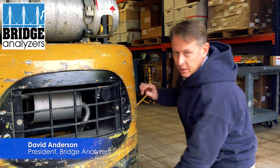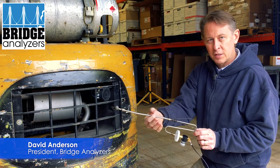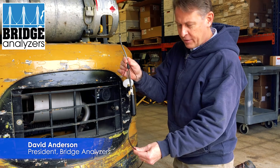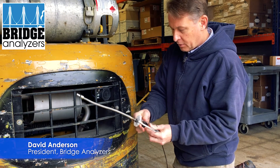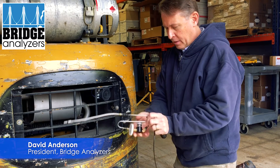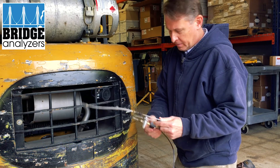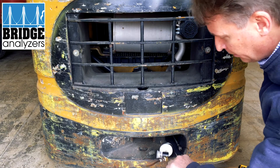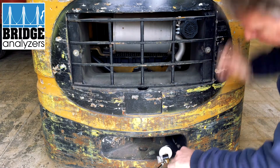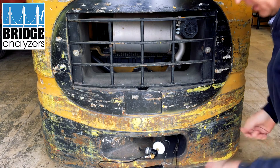While it's zeroing, I'm going to go ahead and put the probe into the tailpipe. You want to make sure the probe goes into the tailpipe directly. I have the sample line connected as well, so everything looks good and snug. I'll snug up the 50 millimeter filter a little tighter and put it into the tailpipe — you want to make sure you get it in there pretty well so you get a good sample.